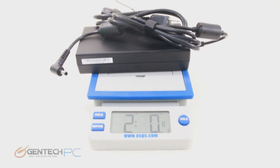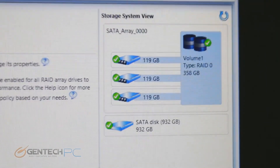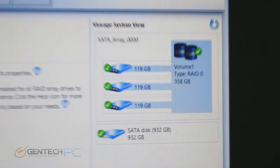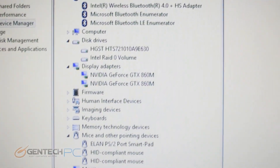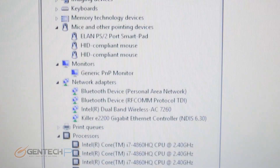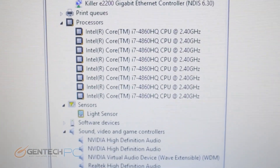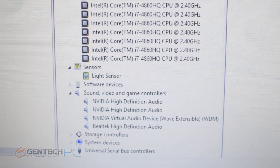That finishes the outside portion. Let's move to the inside. Here is the RAID 0 array of the three micro SATA SSDs — 358 gigabytes of space on one logical drive, striping data across all three disks simultaneously for very fast speeds. In Device Manager you can also see the dual NVIDIA GTX graphics cards and the upgraded Intel Core i7 CPU. The system has four RAM slots, each supporting up to 8 gigabytes, so you can have up to 32 gigabytes of system RAM.